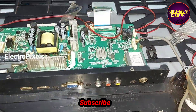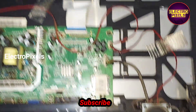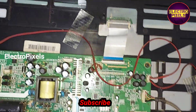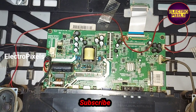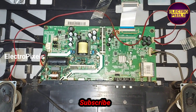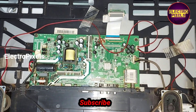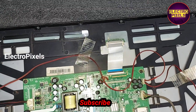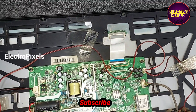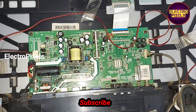See friends, here we open the back cover of the TV. This is the motherboard — it's a combo board. To check the panel we need to open this frame from the TV, so we need to remove this frame. It's a 23-inch Samsung panel, and the model number of the panel is LTA230AN01.